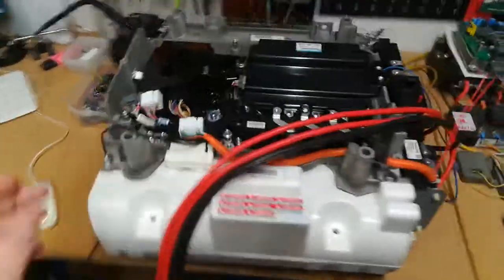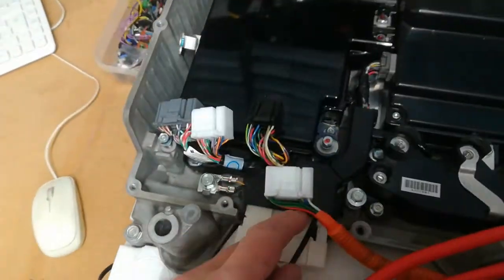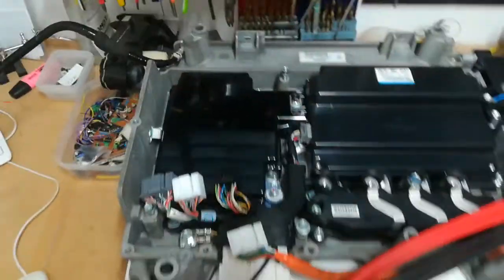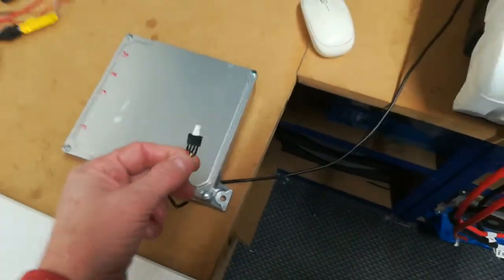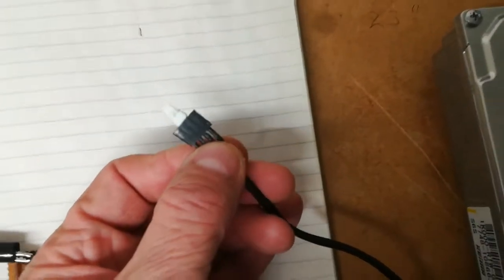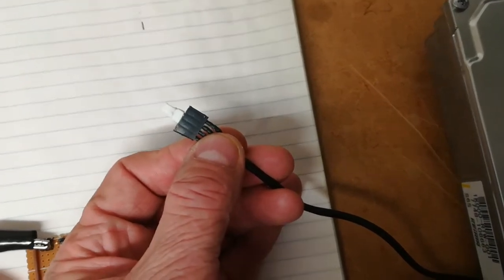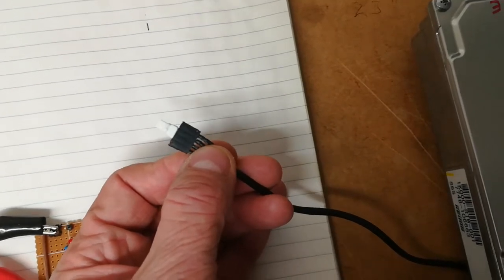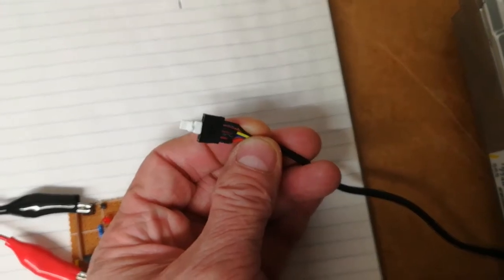The thing today is I've added another wire here. This wire goes into the nether regions of the system, goes into this conduit here and then off into the IPU etc. It's basically four wires - power and signal - and this is the wire we'll use for voltage hacking to allow us to hopefully add extra blocks of LTO cells to up the voltage to 144, 160 etc, and hopefully increase the motor power to at least 15 kilowatts or more.